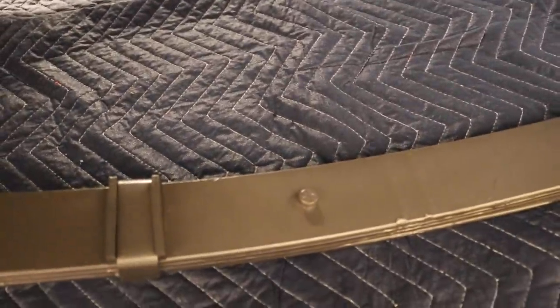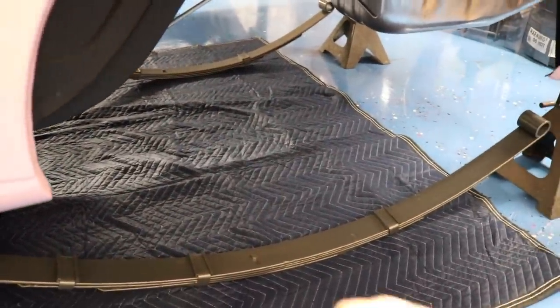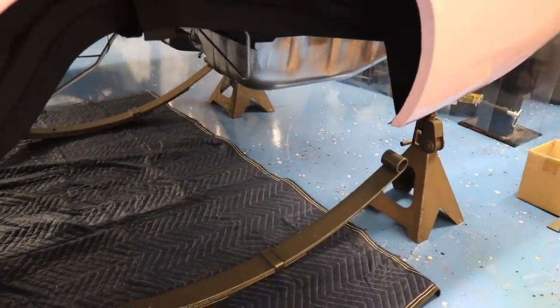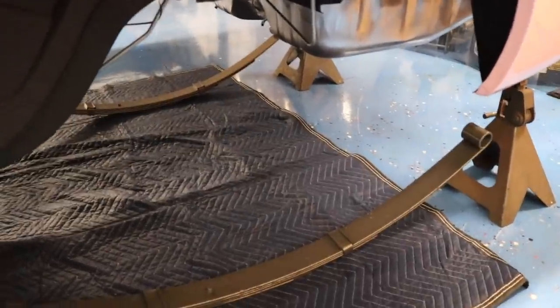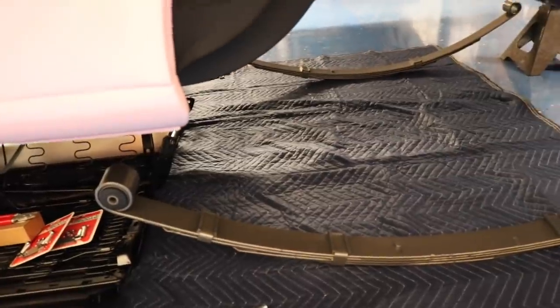So I'll swing those front ends up, I'll set the rear end in place, get it on those locating nubs, and then I'll put the hardware on those U-bolts to somewhat clamp it down so I can jack up on the rear, raise the whole back end up, and then I could put together the trailing arms of those leaf springs and just keep going from there. I'll put the shocks on until it's all together. So I'll bring the GoPro under here, set up a light so everyone can see, and we'll get this rear end in the car.